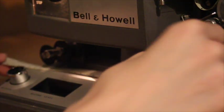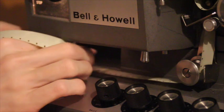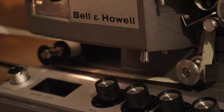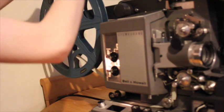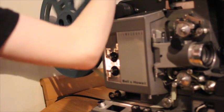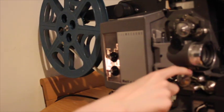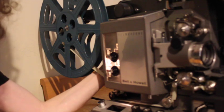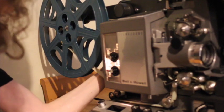Make sure it's going under the roller here, and on the back there are actually two rollers — make sure it wraps around in an almost figure-eight around there. Then quite simply, put it back onto the take-up reel. One thing you'll want to do is make sure you have everything locked; they're easy to miss and will cause you headaches if not done properly. You can then use the inching dial on the back of the projector to make sure everything is in place and moving nicely.